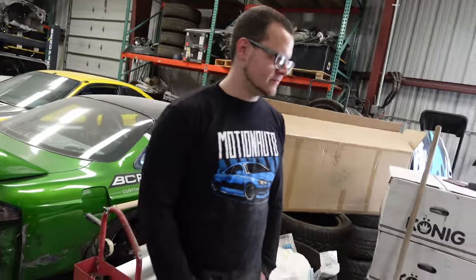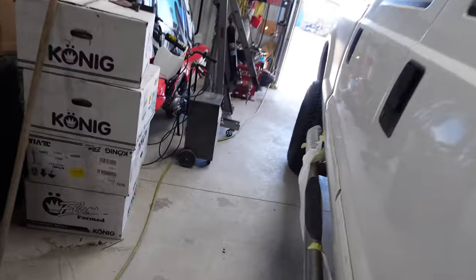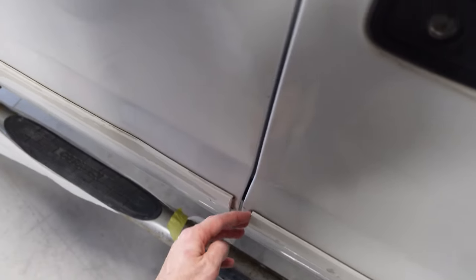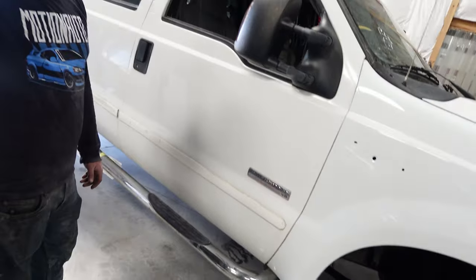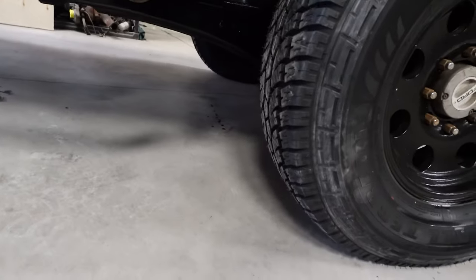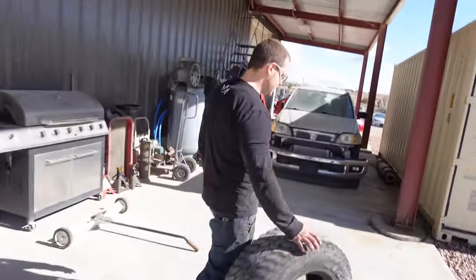These things are a major pain in the butt. So we'll hit them with a heat gun, then get a razor blade - I think it has two strips of adhesive. We'll heat it up and try to cut it with a razor knife close to this edge, leave as much of the double-sided tape on the body, then use that eraser wheel to get everything else off. What do you think about that leak? Definitely has a leak. We could pull the tranny, do a rear main seal, and drop the pan out of the bottom - basically do the oil pan gasket too.